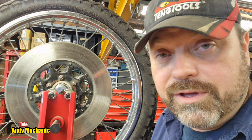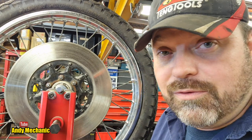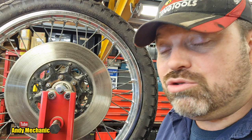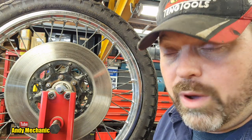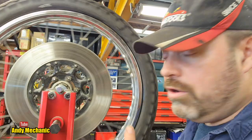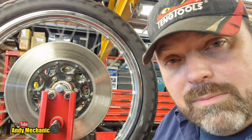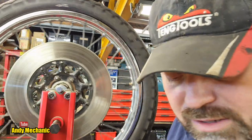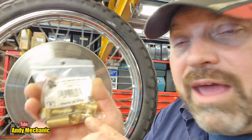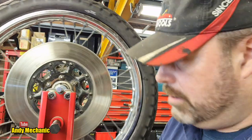Now this is really obvious, but it doesn't always happen: it's really important that you remove all the old wheel weights before you try to balance a wheel. I've seen people leave the old weights on car wheels and try to rebalance — all you end up doing is loading the whole thing up with extra weights it doesn't need. So just check around the rim and make sure there are no weights on. On these old spoke wheels they often used a lead-type crimp weight crimped around one of the spokes. I've got these brass type weights held on with a little grub screw.